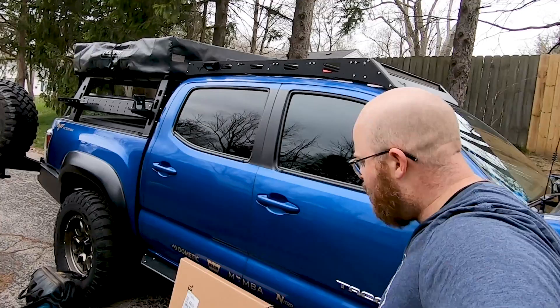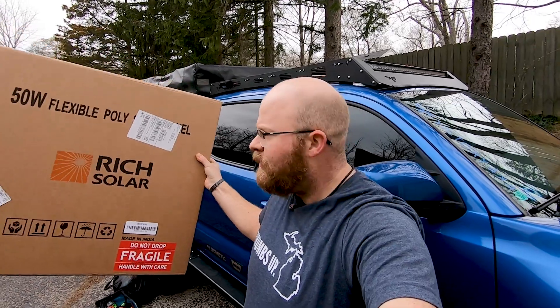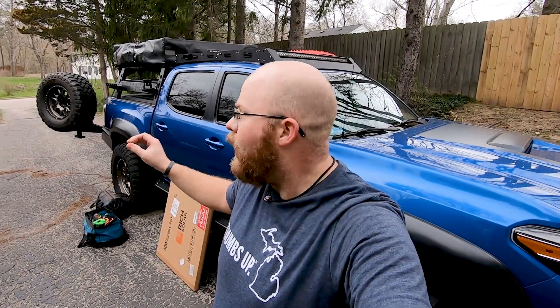Really cheap and easy was my goal. So I went to Amazon and just ordered a 50 watt flexible panel. You can actually do these bigger — 80 watts, 100 watts — but the 50 watt was like 24 by 33 inches, a really great size to not take up so much of your roof rack. If you want solar for running refrigerators and stuff off road, go with a bigger panel, but I'm just looking to keep my batteries topped off. I do have dual battery and a fridge in this truck, so I have tons of capacity. The solar is just going to add a top-off for when the truck sits, and in an emergency I could turn everything off and trickle charge the batteries.